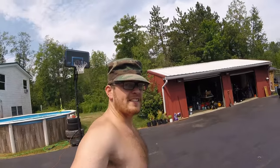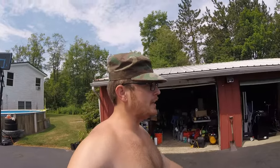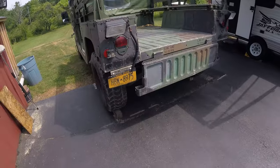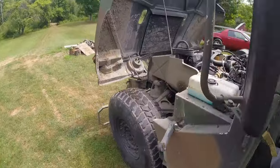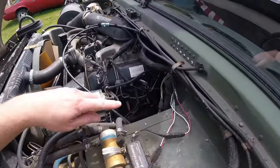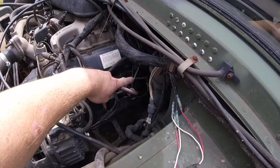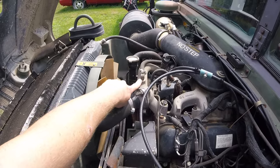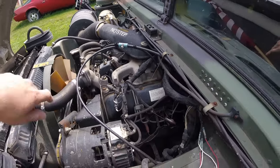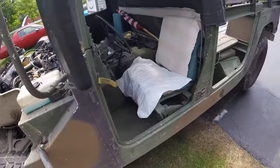Today we're working on the Humvee, installing the advanced cooling kit on the 6.2 liter GM diesel. Apparently the rear bank of cylinders has a tendency to get hot, and there are drain plugs back there that can be removed to vent coolant flow. This is supposed to reduce engine temperature, increase efficiency, and help with cooling overall.